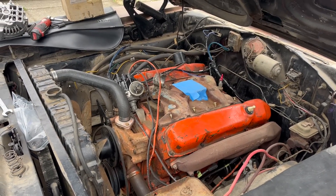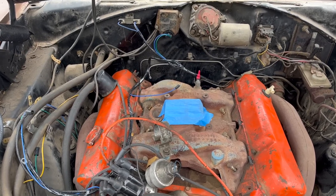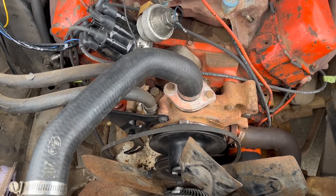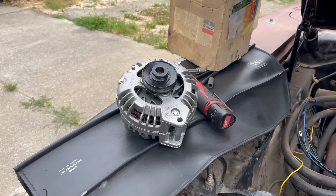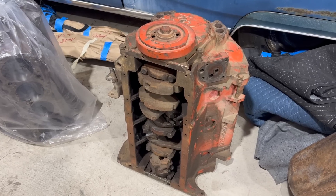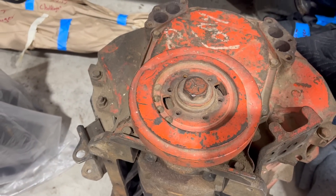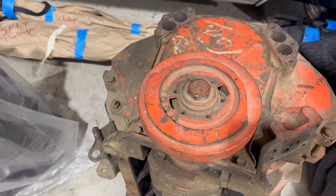That's the main thing we want to fix today. My co-worker Evan's actually already been busy in here. He's installed the brand new engine harness — it's not booked into the firewall yet for some reason, but everything's kind of sort of routed. He also took the liberty of replacing the water pump. Judging by the debris Tom left here, we're also changing the alternator. The original engine is right here. Admire the special six-pack harmonic balancer with the D-weight on it.